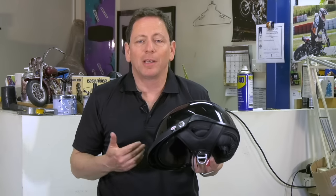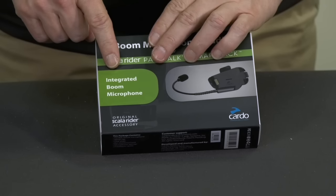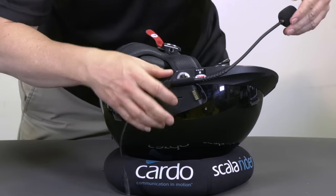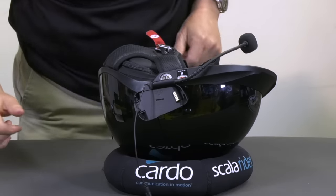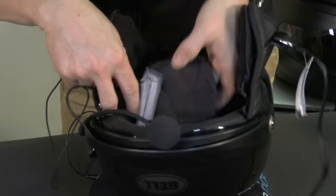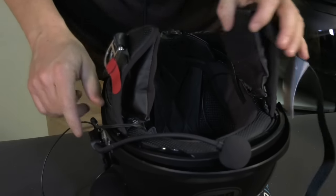We've just finished installing the Packtalk audio kit on your helmet. Your audio kit has two sides: a connector side and a release tab. To insert your Packtalk, start with the connector side and then press firmly on the back side until you hear a click. To release, push down on the release tab. For a half helmet, make sure to have one of the half helmet kits first — the integrated boom microphone kit is available at any dealership. Depending on your half helmet, use either the clip-based or glue-based solution. Attach the cradle, adjust the long boom to its correct position with the yellow triangle directly opposite your mouth, slide the speakers into the correct location, and run the long cord through the top inner side of the helmet. Keep in mind that every helmet is different and may require some adjustments — when in doubt, contact your local dealer.